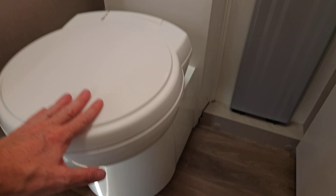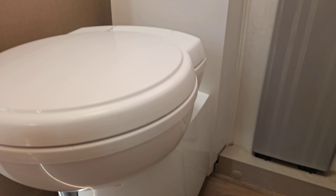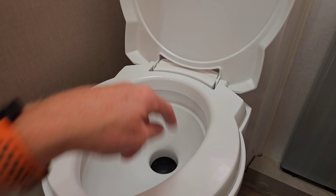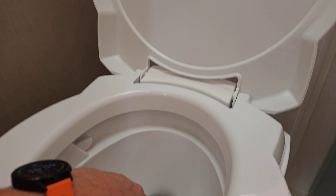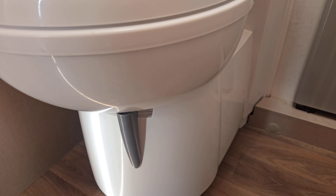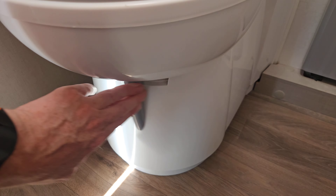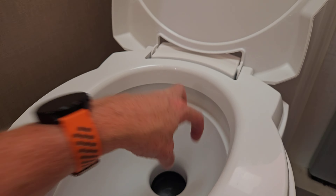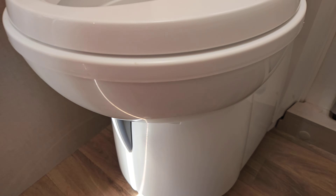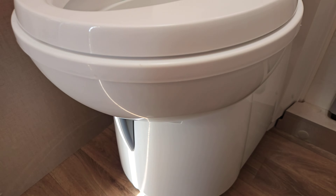In the bathroom, the flush tank sits in the top section and the cassette sits in the bottom. Use the toilet in the normal way. The flush button is just here — press it to fill the bowl with water, which will be colored with whatever chemical you've put in. To open the gate and allow everything to drop down into the cassette, move that lever over to one side, then push it all the way back over to lock it. That seal keeps all the smells in, so make sure it is pushed all the way over.